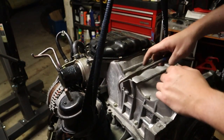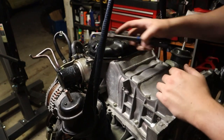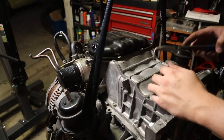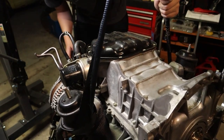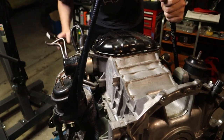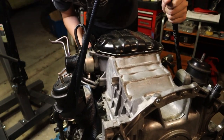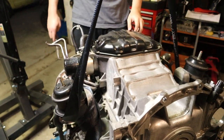So we've got to remove a bunch of 12mm bolts around this assembly, and I'm gonna have to take off this hose to the oil cooler sandwich plate. And then outside of that, I might have to remove some of this bracketry to get to this bolt down here. Probably use a ratcheting wrench though on that bolt. Shouldn't be too difficult.